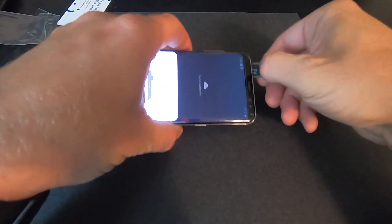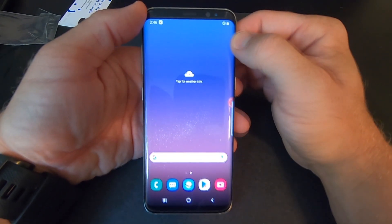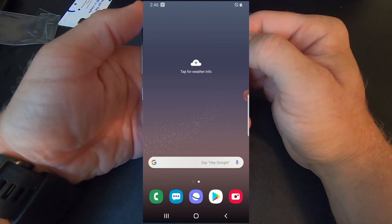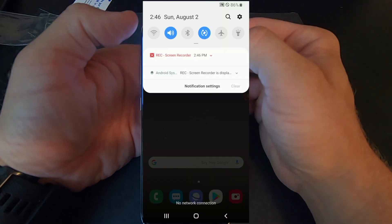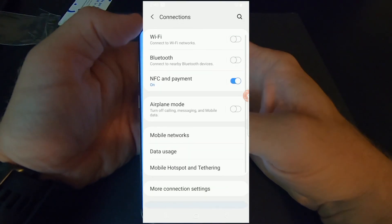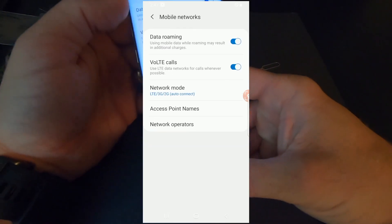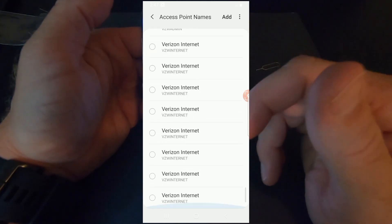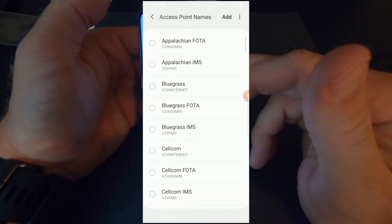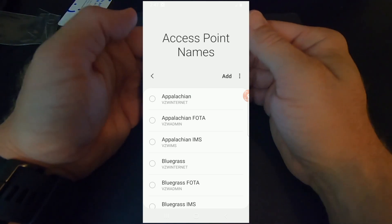I'm going to pop open the SIM tray. You can see — no service. That is what you will get. On your unlocked phones, you may get a couple of bars, but don't be fooled — that could just be another network. So if we go into Settings, Connections — this is on a Galaxy phone, other Android phones will be similar — Mobile Networks, Access Point Names. You'll see this is what happens on an unlocked phone when you put in a SIM card that it doesn't understand: you get a bunch of different options — these are all different Verizon MVNOs — but unfortunately Visible is not in here. So we have to add custom APNs.